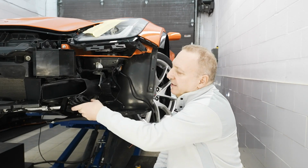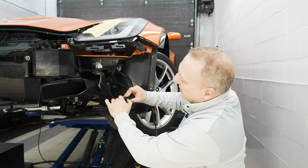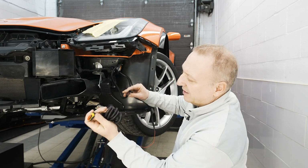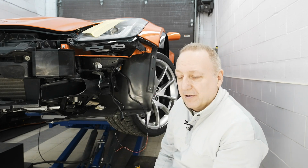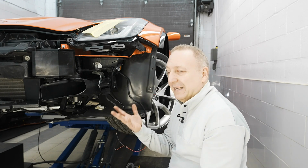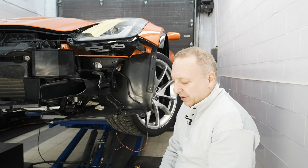Controller fastened. This is the harness powering up the two LED lights. There's a tab on it. Slightly pry on it and just pull out. And there are our pins. So this is going to get installed on our bumper assembly. If ever somebody has to service the bumper, this is what they're going to be removing. This plug right here lets you remove the bumper without having to do any mods or snipping. So it is not a permanent modification we're doing to the car.